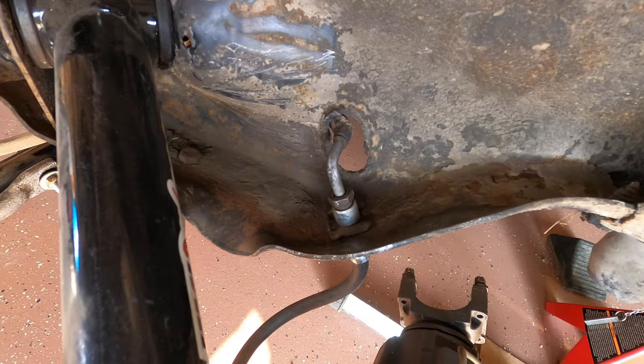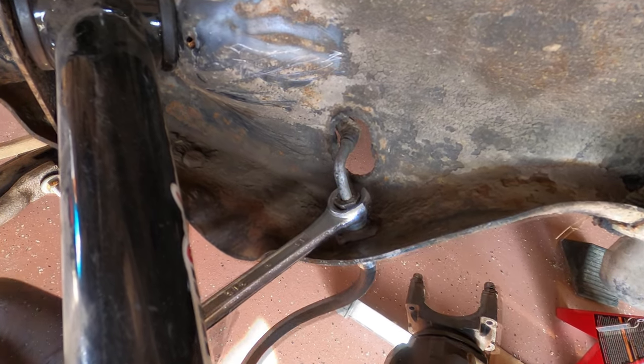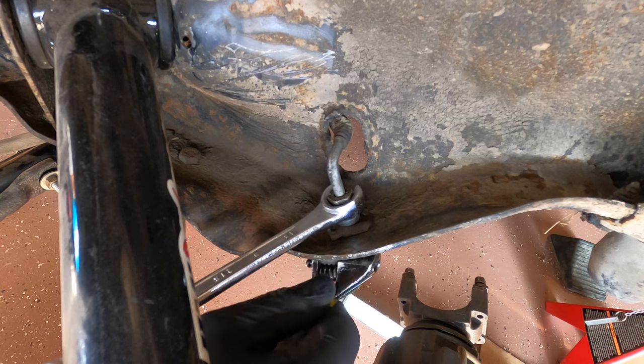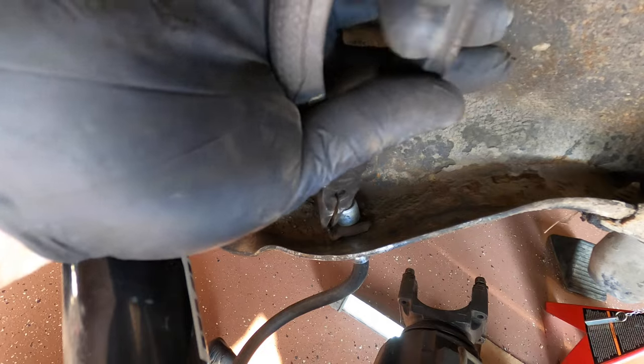The brake line is hitting up here. My 15mm brake line wrench was a little big, but it worked. I used a crescent wrench on the bottom side and had no problem. Used pliers to pull out the shim and the brake line will slide through the hole.